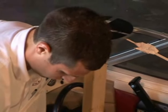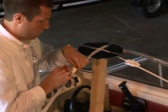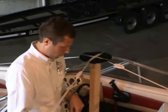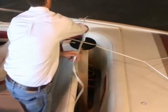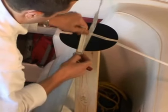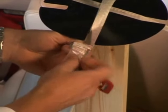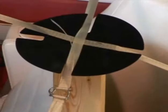We like to put some tape on the buckles so that they won't protrude through when the shrink wrap is hot. On the top of the support pole we are also going to put in a staple to hold the pole upright. Ryan is going back to put a buckle in the strapping going side to side over the last pole in the back of the cockpit. The buckles allow you to adjust the tension in the strapping, and the tighter the upright support structure is the better. Our thinnest shrink wrap will hold 256 pounds per square foot, which if it is laying inside a boat cover can cause some damage.